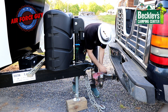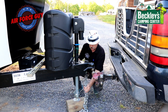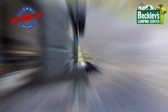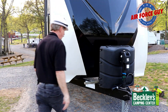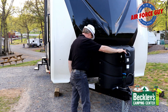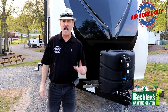Now it's off. You want to make sure that you get the rest of your stuff off — I already have the chains off, break-away, and now I have the electrical cord. I just need to pull forward. Now it's just a matter of making sure that we're level front to back. I'm able to look right here — looks like I need to go down just a little bit. And there we are, now we're level.